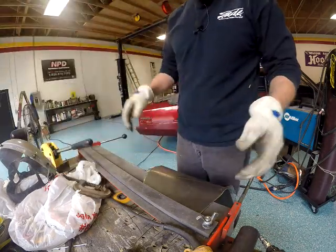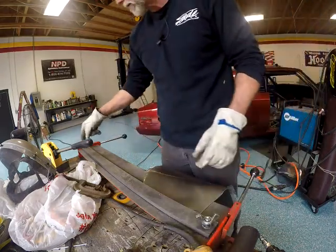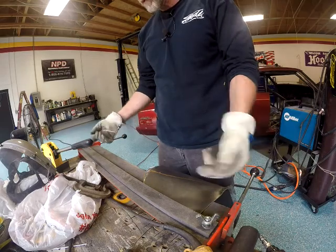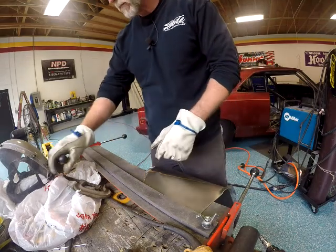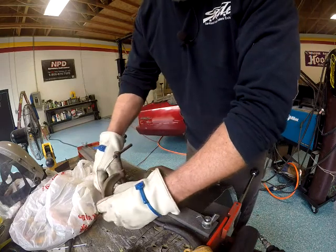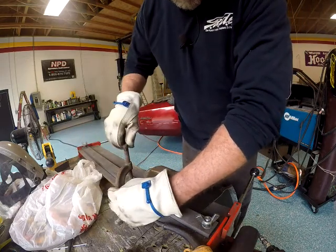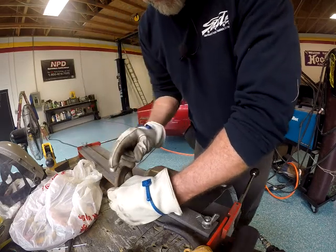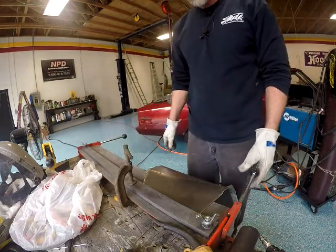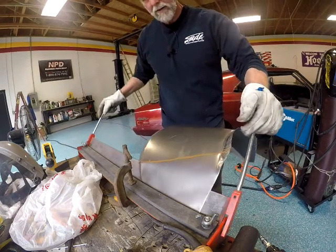because otherwise you were just to hold it with clamps and then see the motion of my hands. When you go to bend something, it would just push it away from you. So the bolts hold it in place, and then that clamp holds the center down, and it actually works out quite well. I mean, you're not going to bend quarter inch steel, but what brake are you going to bend quarter inch steel?